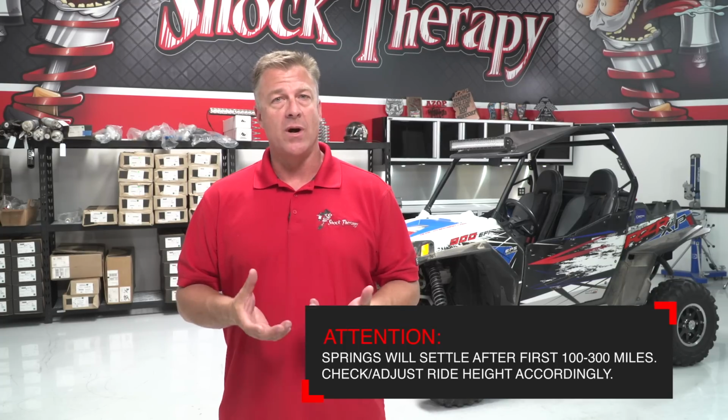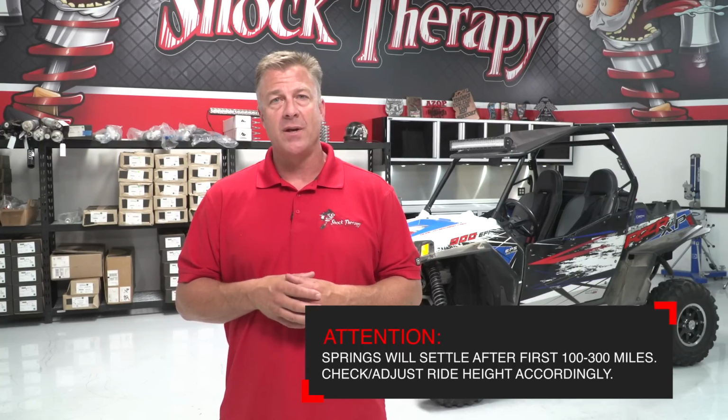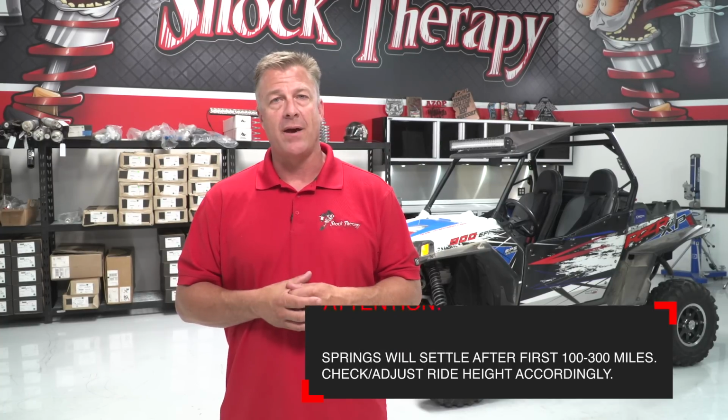Drive the car for 100 to 300 miles. Check the ride height throughout that time and you'll find the springs settle about 1/2 inch to 1 inch max. Once they do this, or at least once you reach the 300-mile range, raise the car back up. This is the only time the springs will settle, one time over their lifetime. From this point on, you won't have to adjust it again.